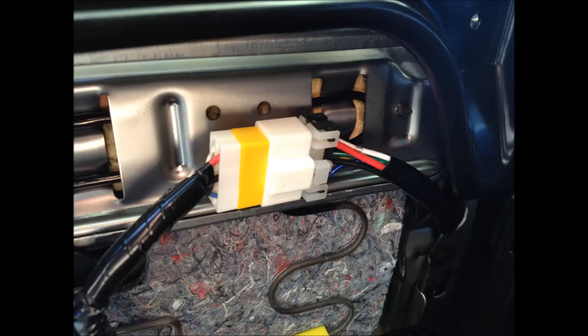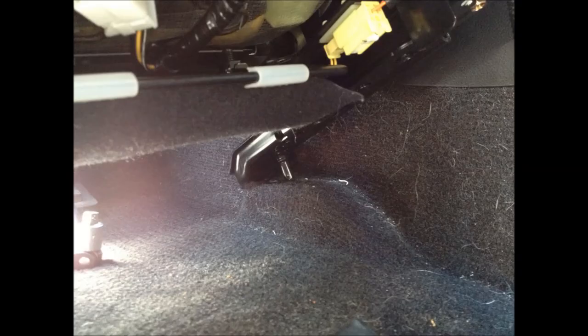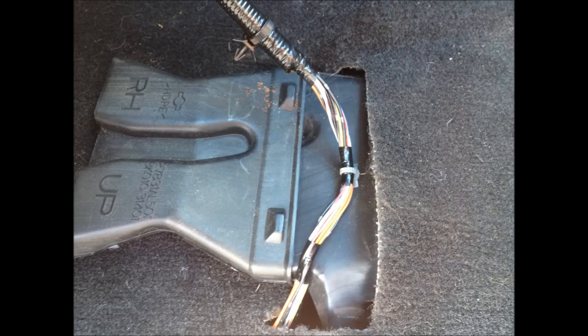Now it's time to align the seat. There's a pin that sticks out on the bottom corner of the chair and it goes into the hole that's furthest forward. I'm lightly bolting the back ones in and then going to put the front ones in first — that way I know they fit. I'm going to move the seat back just a little so I can still get access, but get the front ones in first. By now I've tested the controls and I can hear the seat move back just fine.